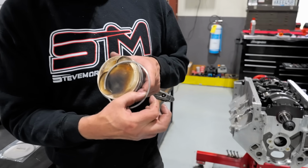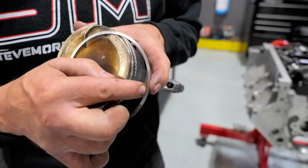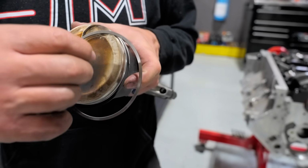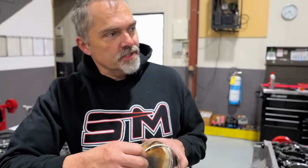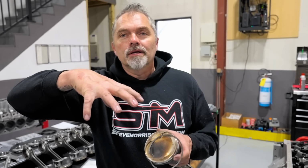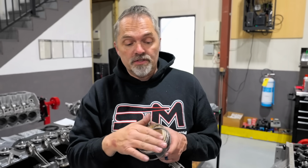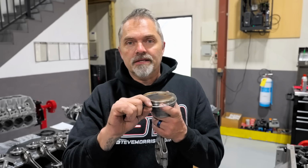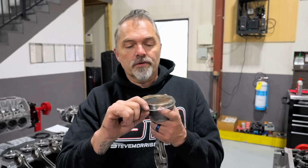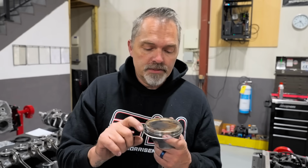So this thickness right here is called your radial wall thickness. From that face to the inside face, that's radial wall thickness. So the thicker that dimension, basically, the more radial tension it has on the ring. So that really is where it's all controlled. If it was thicker in vertical thickness, if it was a 1/16 ring, yep, it adds more tension. Well, .043 is less. Or, I'm sorry, .031 is really less.